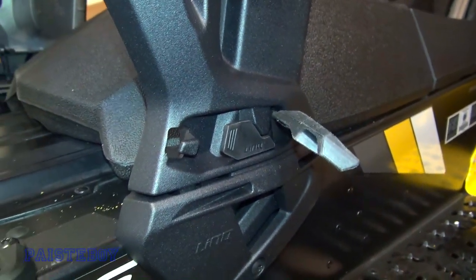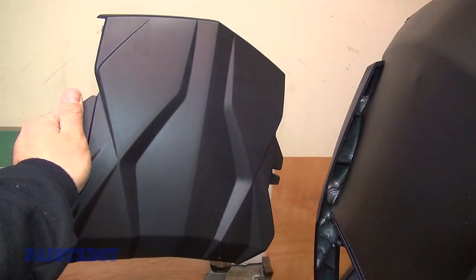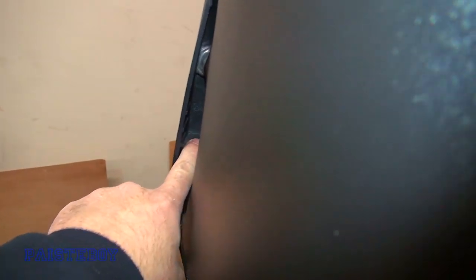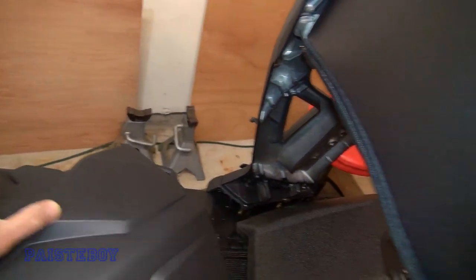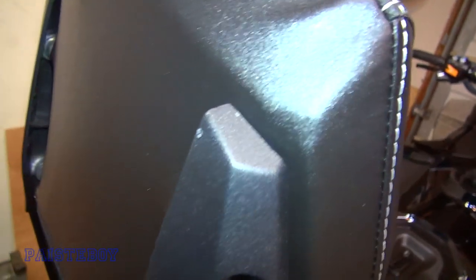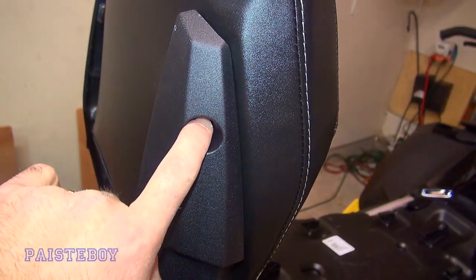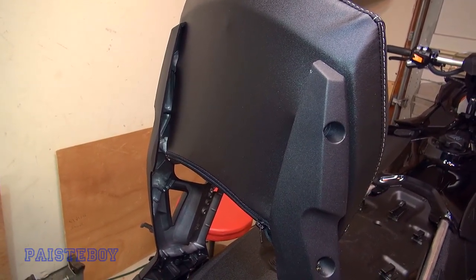Now that I've got the upper part started, I went ahead and locked these up. Okay, so we're about to install the backrest cover — it goes on the back. If you look inside here, you'll see a little vein or channel, and it corresponds with this on the backrest — that's the orientation that'll go on there. There are also little tabs on the top here too. You have to pull this apart before you put these bolts in in order to install that. So I'm going to set the camera on the tripod and we're going to put this in.